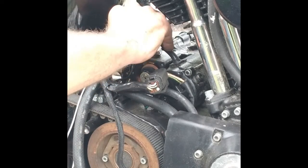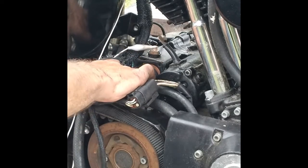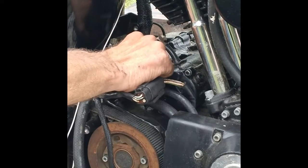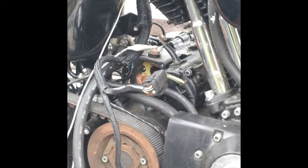I just had this one out and looked at it — it looked new. This one down here looks fairly new on the bottom. Even the contacts on this big copper washer definitely ain't burnt. But it ain't making no contact — 2,500 ohms of resistance, and that should be zero.